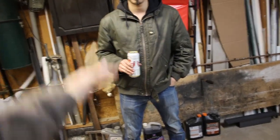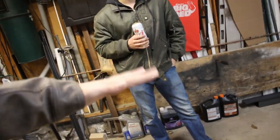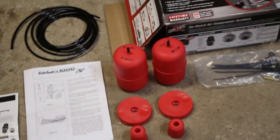Basically, the rear is going to squat when you accelerate and the front's going to lift, and because we're front wheel drive, that's a problem. It's going to prevent articulation in the rear by stuffing up the rear spring with that.